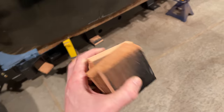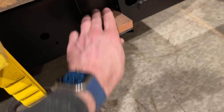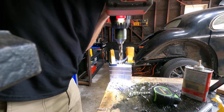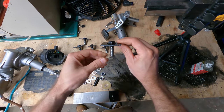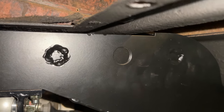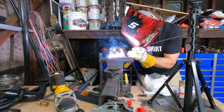To fit the battery modules, I needed to raise the body up off the frame by about three quarters of an inch. Some of you remember that I had cut up some wood as temporary spacers. Wood probably isn't the best long-term solution, so I made some aluminum spacers. I also had to remake the bolts for these. The bolts are just welded to square plates, since it's hard to get a wrench and socket up on top. I had originally thought about angling the body on the frame a bit, but it got a little too close for comfort in the rear, so I went with three quarters of an inch all around. Easy enough — cut and drill some square washers, weld, and paint.